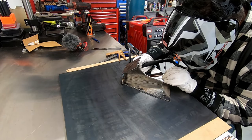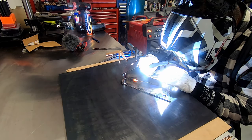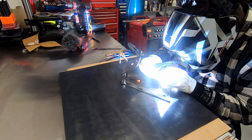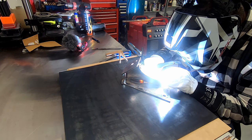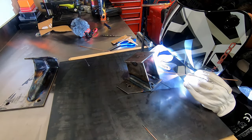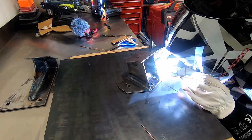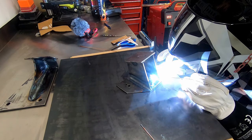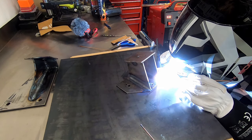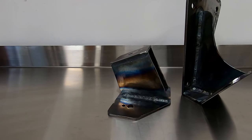After you've tacked them, go ahead and stack some dimes or lay some slag — it's entirely up to you and your welder at this point. I'm using the Renegade 200 Amp AC-DC Inverter TIG with 2.4mm filler and 2.4mm purple tungsten. Here you can see the raw unfinished product. I've knocked down all the sharp edges and given each corner a radius to keep things looking pretty. Now we can bolt these up and start on the trans mount.